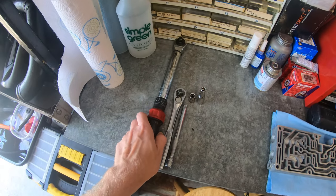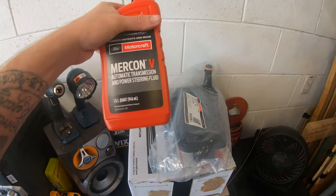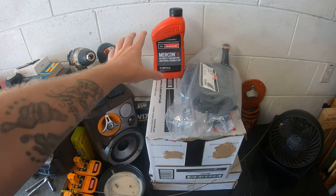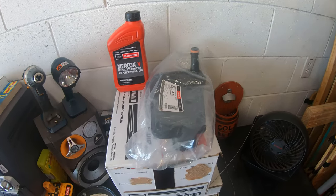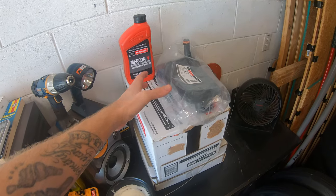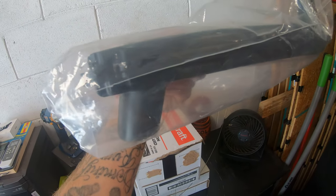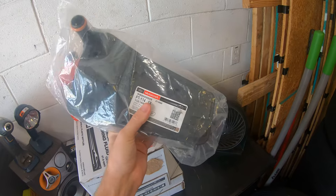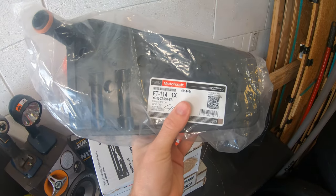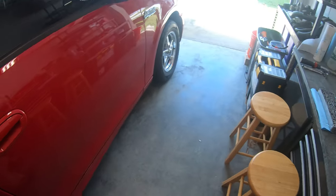This install is super easy, there's really not a whole lot to it. All you're going to need is an inch-pound torque wrench, an eight and ten millimeter socket. I've got about eight quarts of transmission fluid — Mercon 5 is fine, Motorcraft transmission fluid. And then we've got a new transmission filter. Whether you have a stock pan or the 4x4 pan will matter on which filter you need, because the pickup length is longer for the 4x4 pan. I'll put links to both in the description.